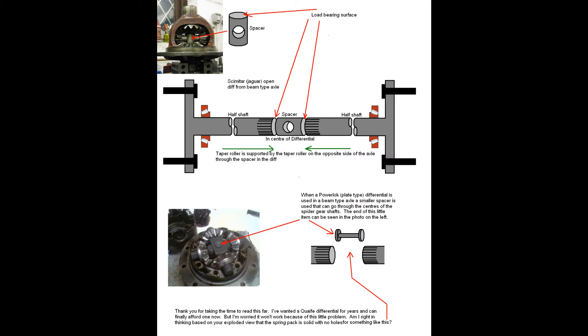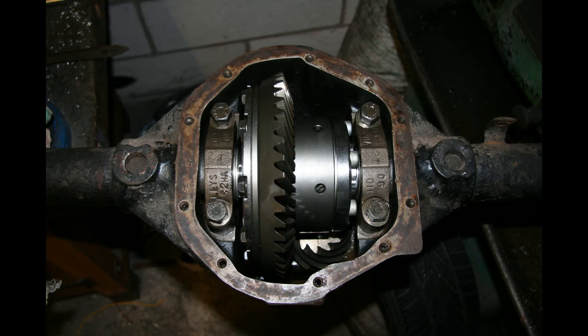There was no good just removing shims — I had to remove some material to push the bearing further into the axle in order to get the preload between bearings correct. Here's the old piece from the open diff which has the half shafts pushing against it. There are twin opposing taper roller bearings on the outside of the axle, and the compression goes right through the centre of the diff. That was fitted — diff all done, the case goes on the back, all caps tightened up, never to be seen again.